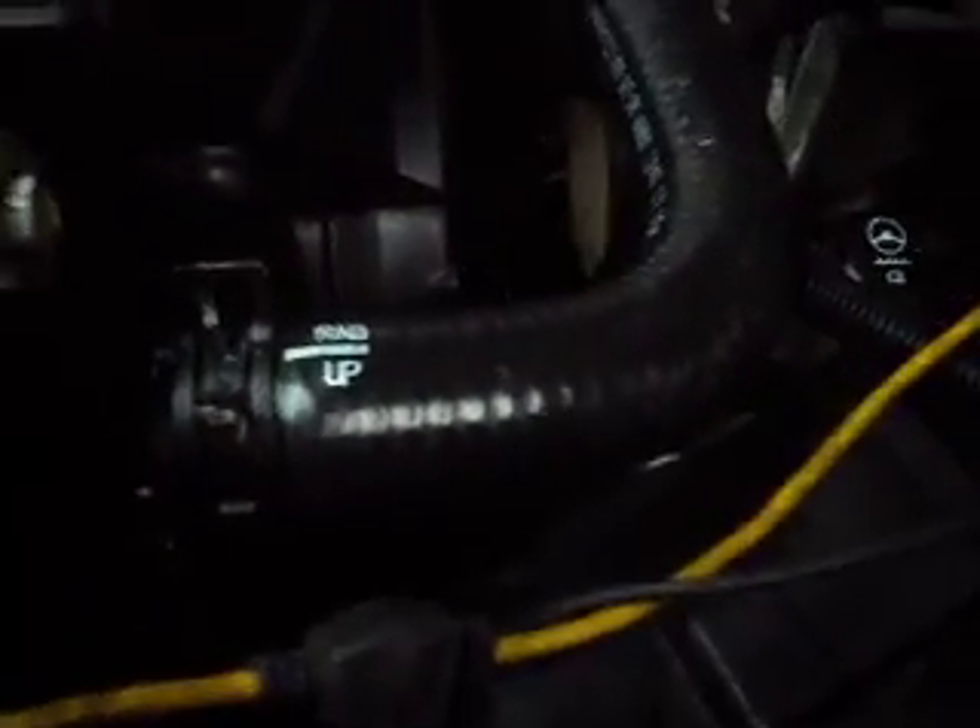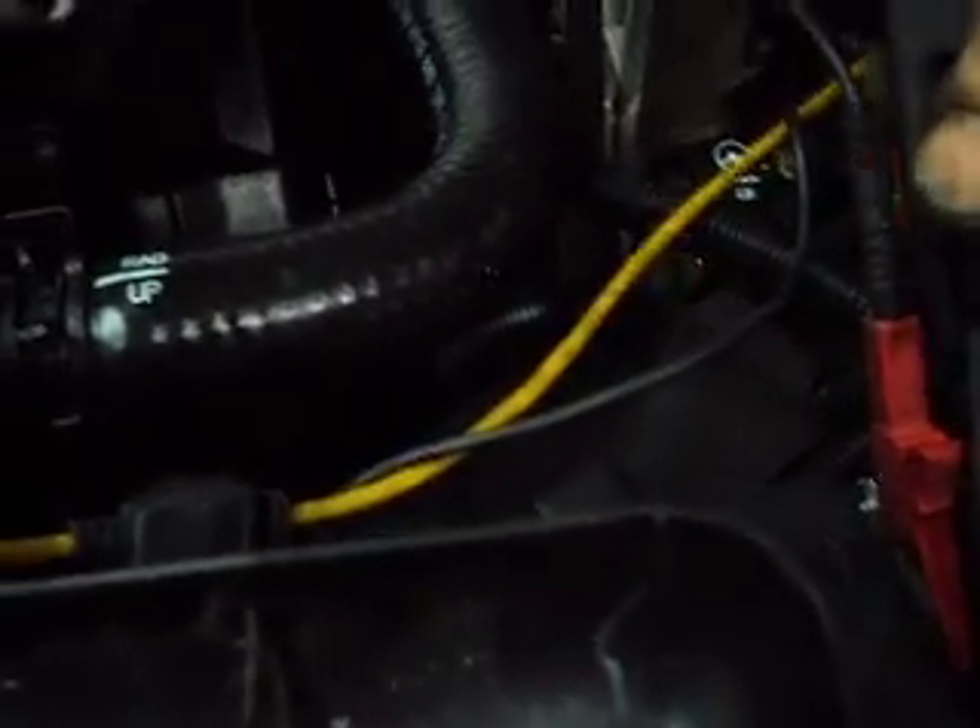We'll take this and put it around the ground cable. We got two ground cables — this is just the one ground cable. You can see the same thing. Only some of the ground is going through the ground cable to the engine; the rest is going through the ground cable through the chassis. We're showing about 40 amps there.